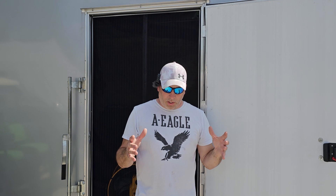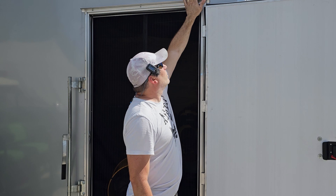Having lithium batteries for this project is definitely an improvement. Let me get out the solar panel and the corrugated panel sheet so you can see our vision. We're going to put both panels right next to each other on this sheet — perfect fit right between the seams up there. The wires will come out the side through one of those cable entry fittings that allow wires to go through watertight. That's stage one. The next video covers the charge controller, fuses, and full layout. This system is scalable — we're doing 200 watts now but you could go up to around 520 or 580 watts with this setup.